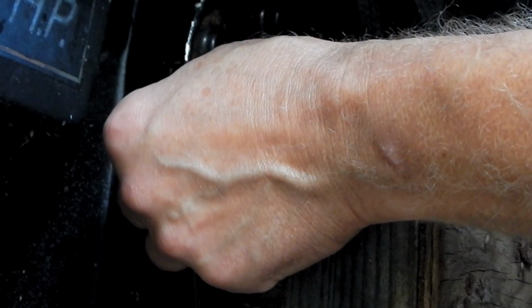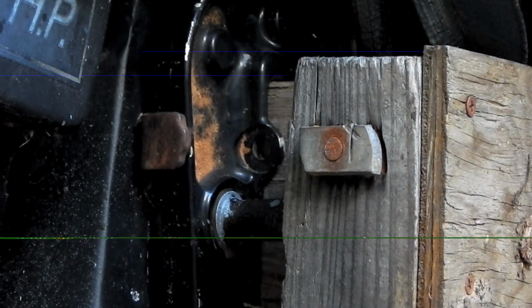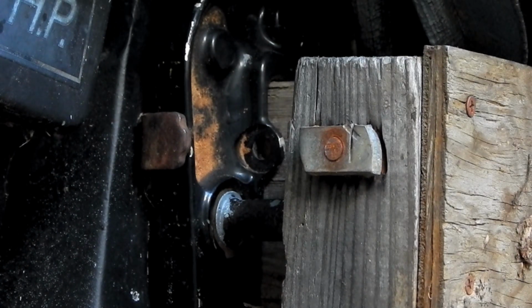Okay, so I couldn't remember. This is 5/16. What's a perfect fit is 3/8. Okay, so I'm going to need to use 3/8 inch bolts to fasten this to the transom. And I would say down here is going to be, yeah, it's the same. 3/8 is your answer. So I hope that helps you out with your project. As for me, well, next step is to get the old Oliver 770 over here and finagle this thing onto the back of the boat.